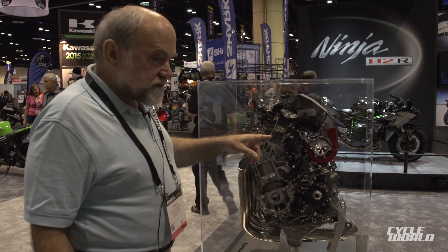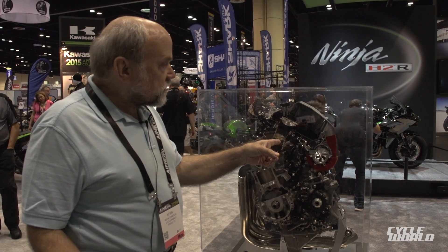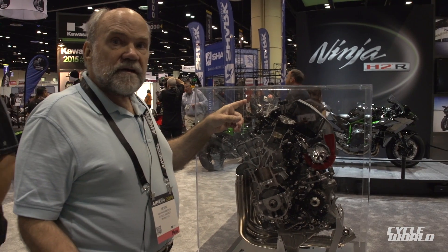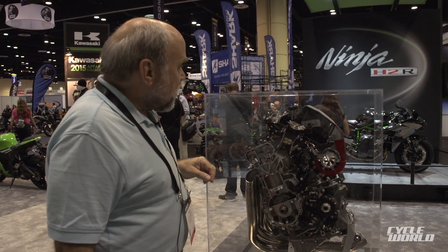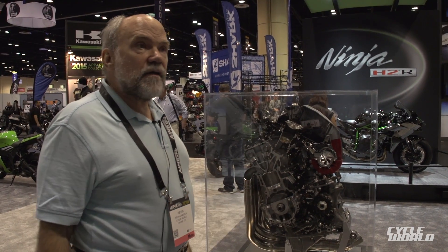What's important here is that the air passes through this supercharger, its pressure is elevated, and the airbox is filled not with air at atmospheric pressure but with super-atmospheric air, so the engine breathes a much denser mixture than it otherwise would.